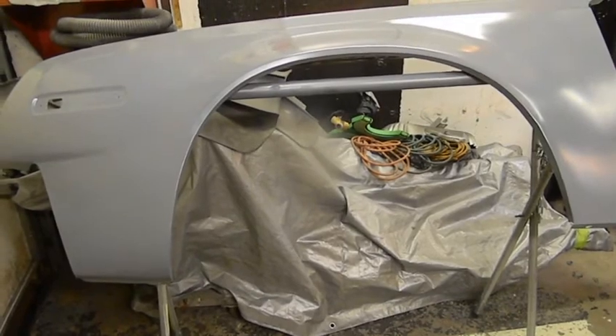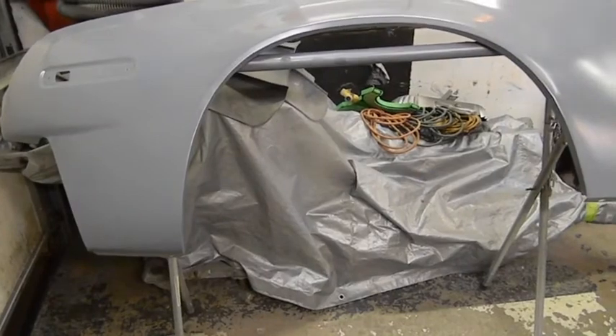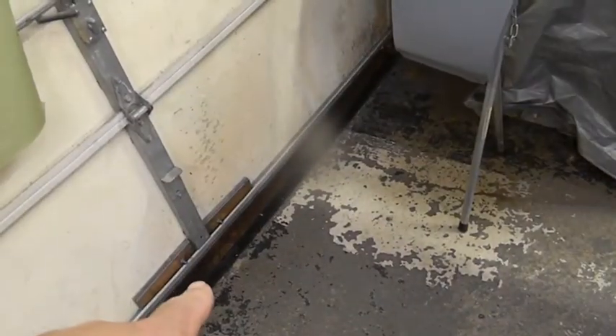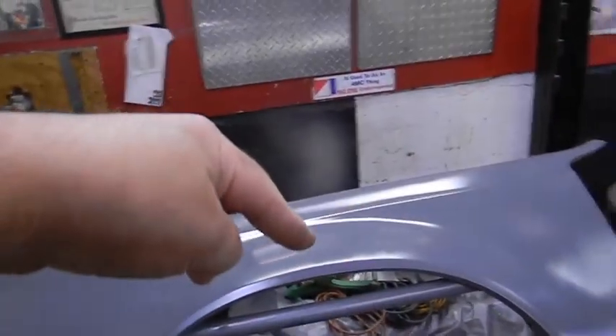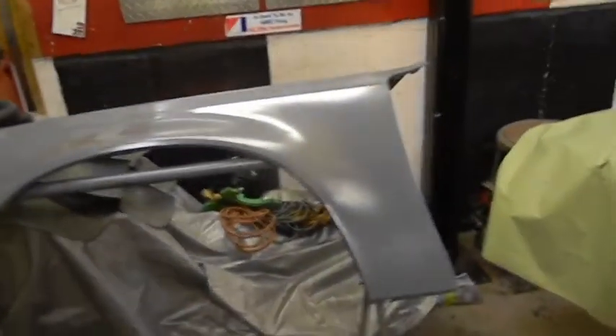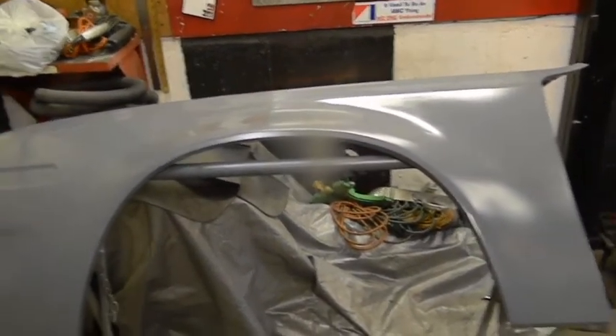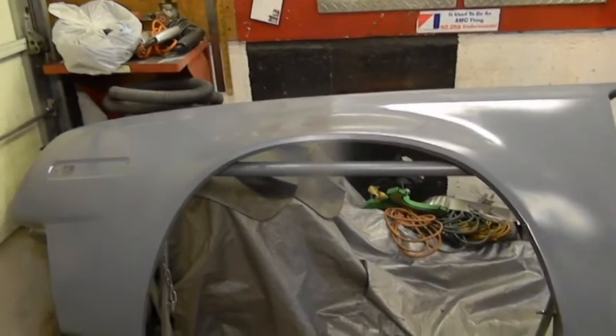I don't really want to open the door — I have air coming in the bottom. The way the airflow is right now, it's only coming in through the small gap on the bottom and in the top, and when it comes across the top since it's all dirty, it's heavy and it goes halfway out. So I usually don't paint right in that zone. I actually have decent luck with dirt — I don't get a lot, especially for garage paint jobs.